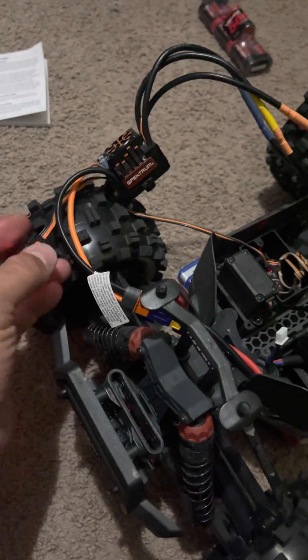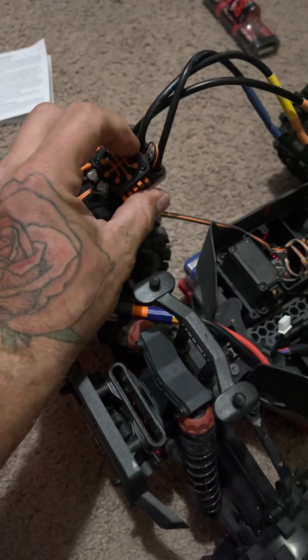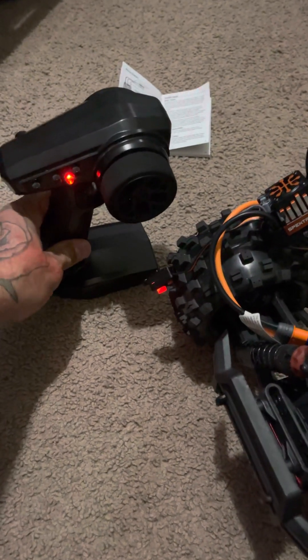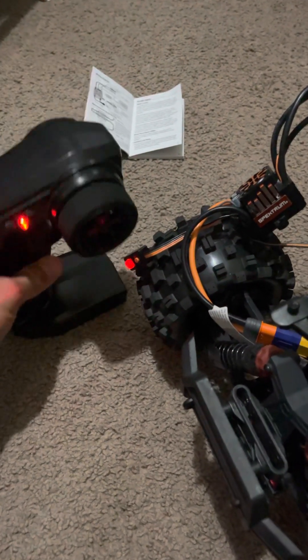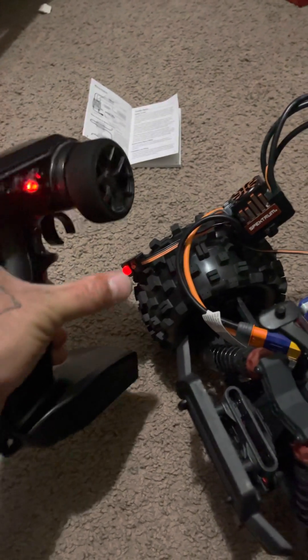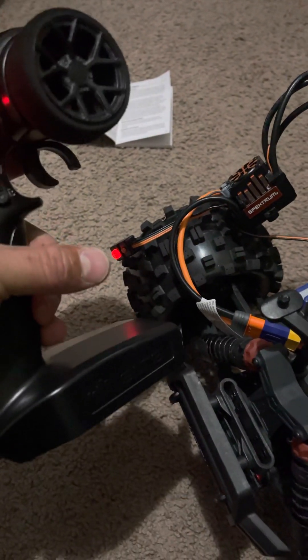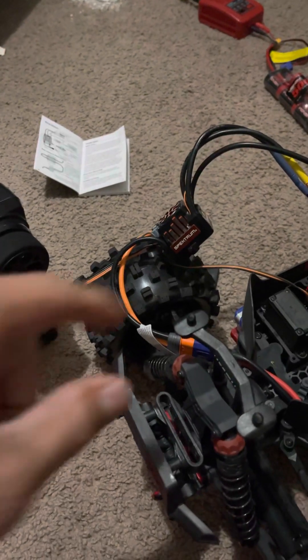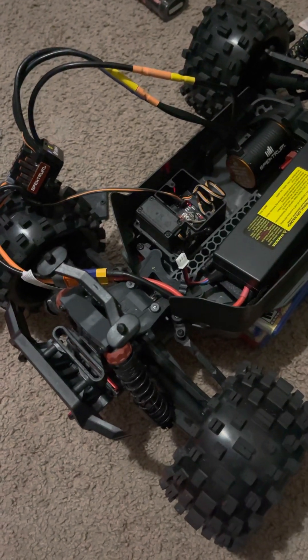A lot of people were asking how do you program them, but that's pretty simple. In the Spektrum one, what you do is press the power and that little button, which is the reset button, at the same time. You're going to have a red light blinking. Then, with your transmitter on, you hit reset, letting the ESC know it's in neutral. Then, while holding the throttle in position, you hit the reset button again and the ESC will beep once. Then, putting it in reverse, you press reset, the ESC will blink twice and beep twice. Then you let it go and the ESC will beep twice again, letting it know the program was set. And then you're pretty much good to go.